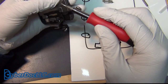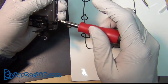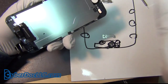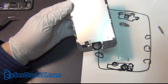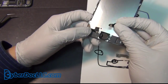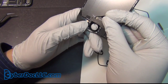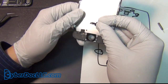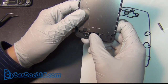When you do this repair, I strongly recommend just leaving these screws alone — you don't need them. It does absolutely nothing but slow down the workflow — pure waste of time. If you want to get a lot of repairs done and fix phones, don't bother with them. So the next thing I did was the home button, so I'm going to put the home button back. Make sure this ribbon cable is back in place, wiggle it a little bit — it does have some adhesive still on it, so just push it back. Otherwise you can always put some fresh double-sided adhesive tape and put the home button back.